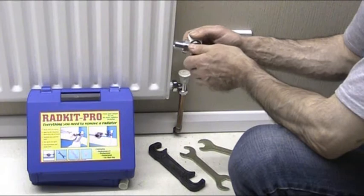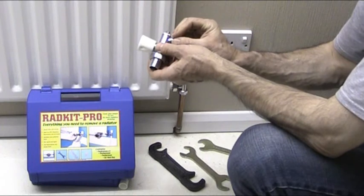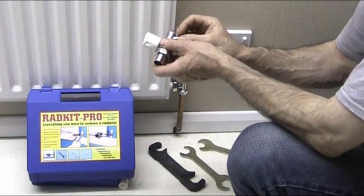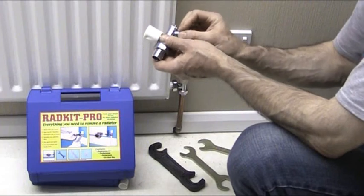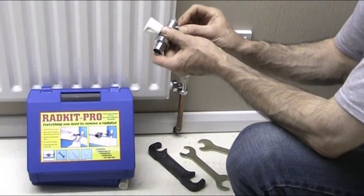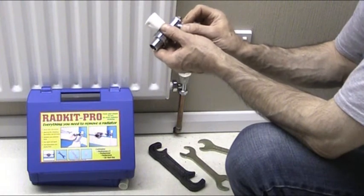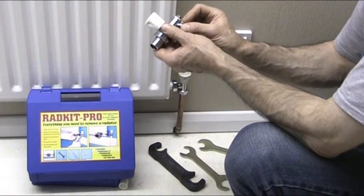If you're going to fit it, fit it at the lowest point if you can, but bear in mind that you need to run a hose pipe — push your hose pipe over that nozzle there and run it out of your door or window to where you can drain it out. You don't want a big long hose pipe trailing through your house or office. A good point is usually in the kitchen or the hallway with the drain off pointing towards the door — you can drain it off very fast then.